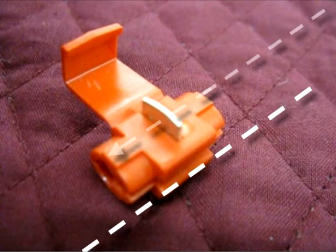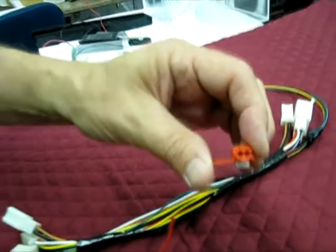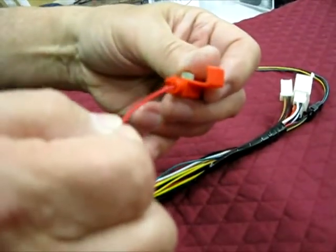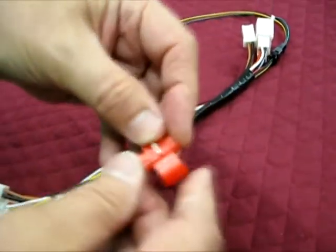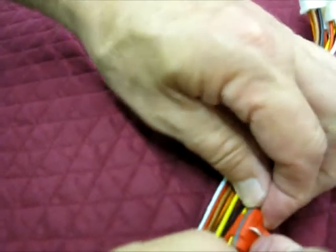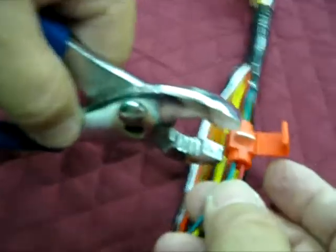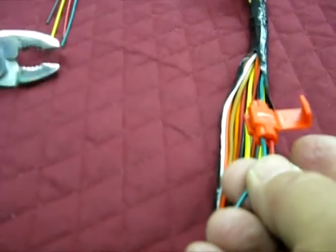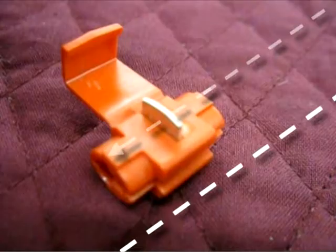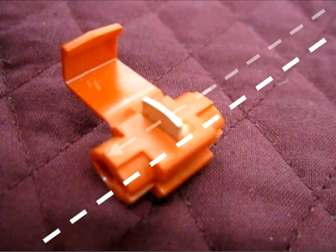When you compress the metal tooth, it should bite into both of the wires at the same time. Push the brake wire into the side of the clamp so they both are under that tooth, then get the pliers and clamp it down really tight and fold the clasp over. It is very important that these wires are in the clip properly before you clamp the pliers down, or else you will not get a good connection and the lighting will not work.